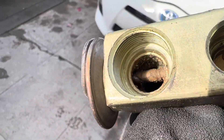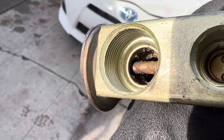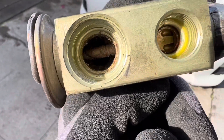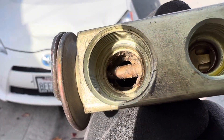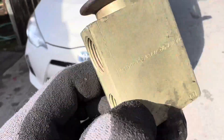You see all that rust in there? This is what happens when you don't change receiver dryers. Guys who put on their hoses that are just left open to the air, and they don't have good vacuum pumps and they don't vacuum. It doesn't matter how long you vacuum — if your vacuum pump can't get down there, you didn't remove any moisture. And this is what happens.